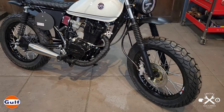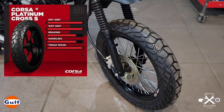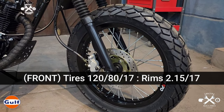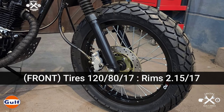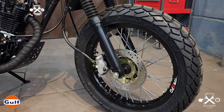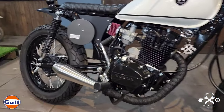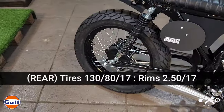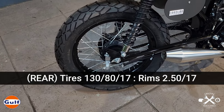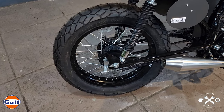Let's start with the tires. The tires used here are Corsa Cross 2 — a multi-sport tire. For the front, we used 120/80x17, and the rim is 2.15x17. So it looks big and wide, not undersized for the motor. For the rear, it's a 130/80x17, with a 2.5x17 rim. That's the tire measurement for those asking.